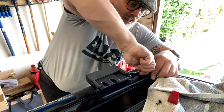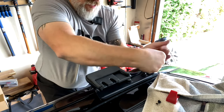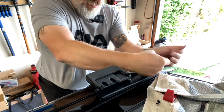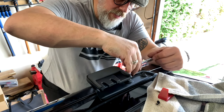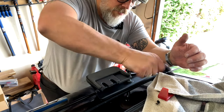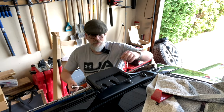The instructions very politely tell you to make sure you've got these rubber dudes on again - this one's the front left. I've given all the others a clean and just popped those in there. Pop your washers on, tip the bolts in and away you go. I think it's a 6mm - I can't fight the hole now, that's not a good sign. These washers aren't very good. It says 32 newton meters - I haven't got one of those fancy torque tools handy, so I'm going to use my ratchet. I have a feeling 32 newton meters is a bit more than this little ratchet can give us.